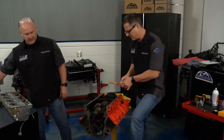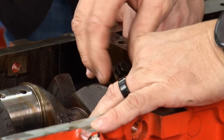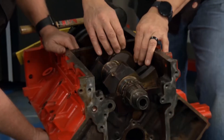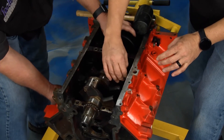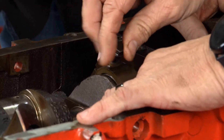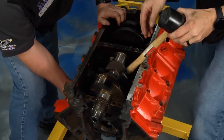They're stamped. Now what we'll do is take this rod cap off — when you take the rod cap off, you may have some studs protruding there. You can take a little rubber hose and put it on there so you don't gouge up the cylinders. But ours just has bolts back down to the actual connecting rods. We'll keep that rod cap obviously matched with its connecting rod.